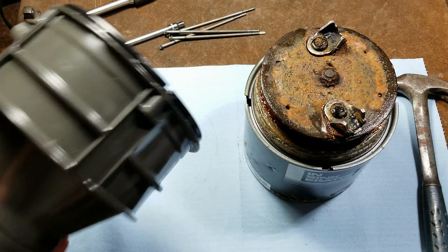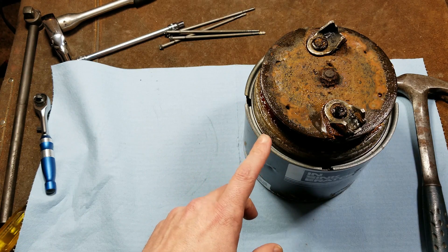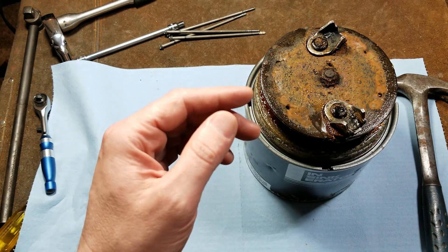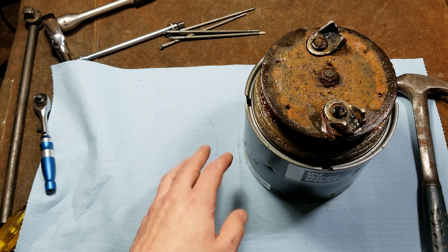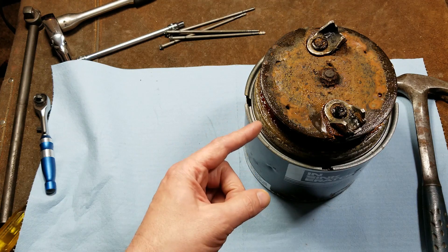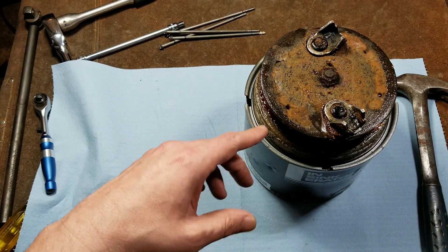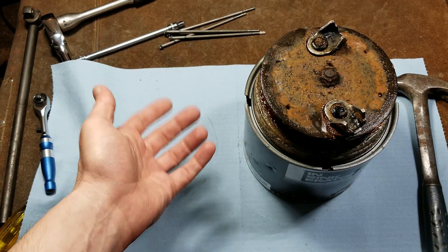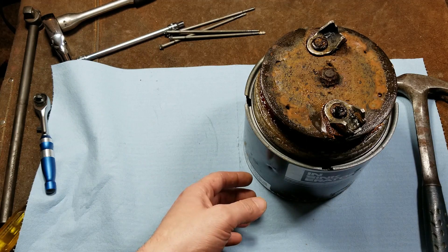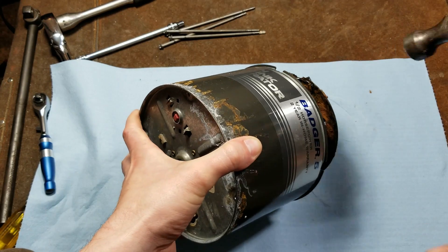Now I think we can get this motor out of here without pulling off the grinding wheel. I'm not going to do that because there are some unspeakable horrors between this deflecting plate or ceiling plate and the rotor. And that's the other thing — regardless of all the ice cubes or anything else you put in, this InSinkErator style is probably the most common in the United States. It's kind of eye-opening to know that there is just a huge gap there that's almost an inch tall and about five inches in diameter, and all this stuff just builds up under there. That's inevitably what causes corrosion, even of the stainless steel — it's always this big mass of ground-up food and water for years on end that eventually makes its way past the seal. Let me get this motor out of here — that's really gross what's under there.